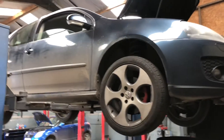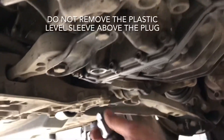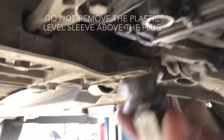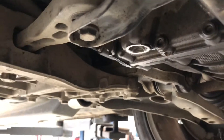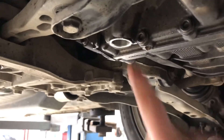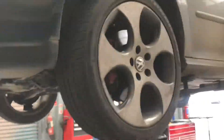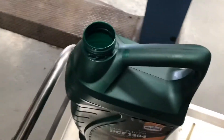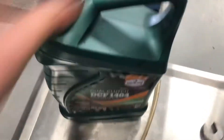At this point the car is running and I have the bung taken out of it. I don't have any oil coming out of this hole, so we're gonna get it and pump some oil back up into it. I'm not sure how much oil is going to go in, so I'm just using a little siphon syringe.